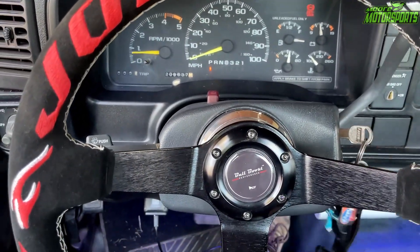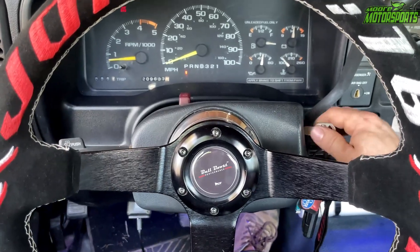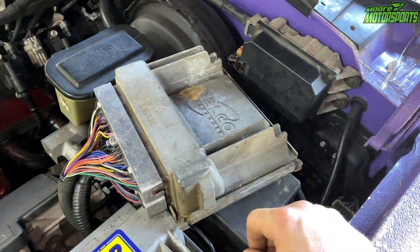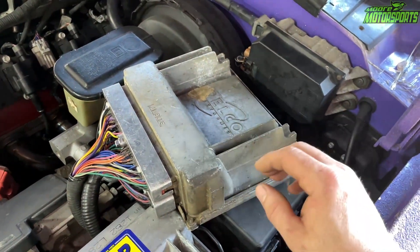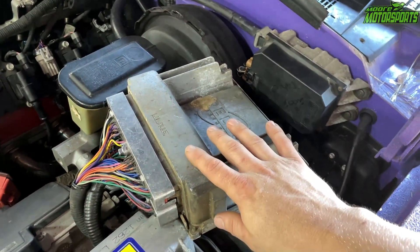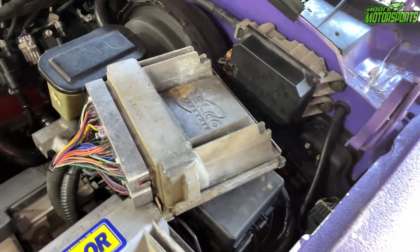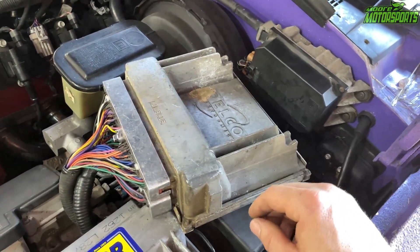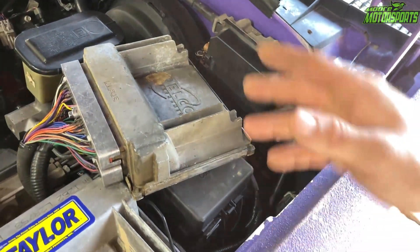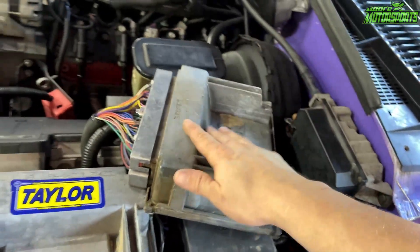Next thing to do is see if it runs. Now that we've confirmed the PCM is good to go, this is ready for an LS swap. You'd need HP Tuners to adjust anything — if you wanted to turn off EGR or O2 sensors or whatever, that would have to be done through HP Tuners. As it sits, this is basically factory level, ready to fire up. For the OBS there are different settings you need to adjust, but this is ready to go for a basic LS swap — put it in an old hot rod or build a drag car and adjust from there.